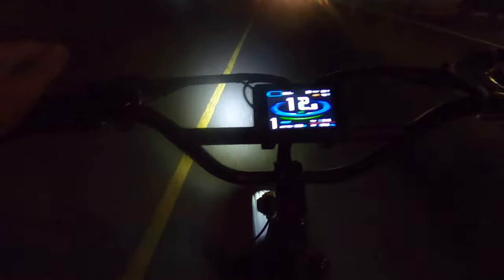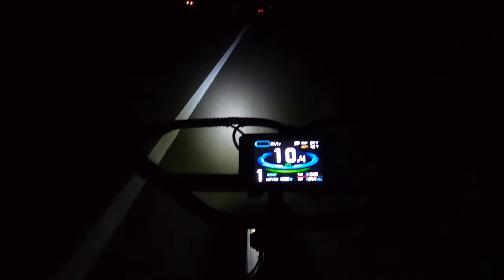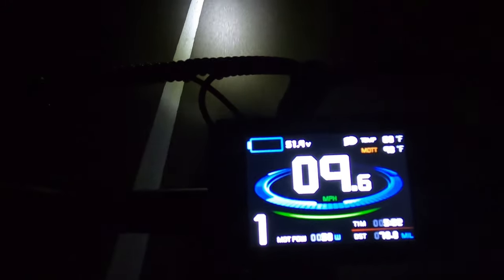Pretty incredible. The way it was going at first, I thought it would make it all the way to 100 or 120 miles. I knew the top end would last longer than the bottom end, but I didn't think it'd be this dramatic. So be aware if you're going on a long ride — you'll lose a lot of that power and voltage at the bottom end of the battery. We're at 69.9 miles — we just hit 70 miles, seven zero. 70 miles, 52 volts while not pedaling, 51.8 while pedaling. We're still getting 175 to 190 watts.